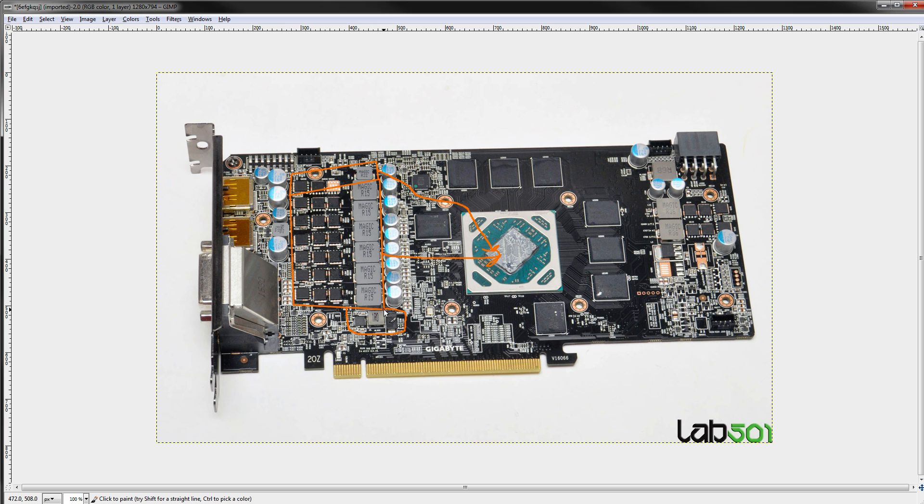Below both of those, we get the 0.95 volts, which also goes to the GPU core and takes care of display-related circuitry. We're not going to look at it in any more depth, because this VRM is really only useful if you're overclocking on liquid nitrogen, and that's not really important for most viewers.